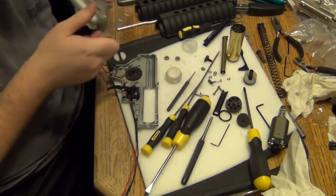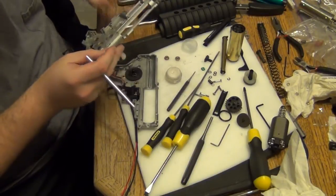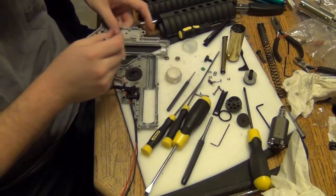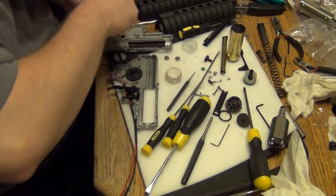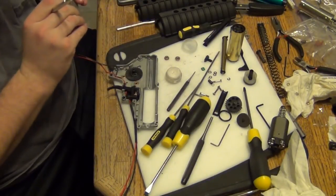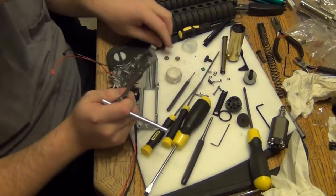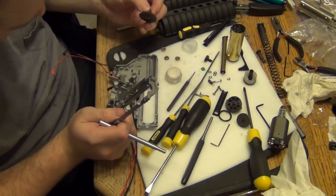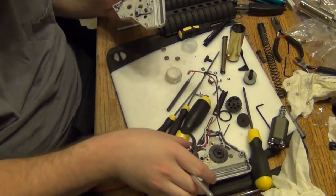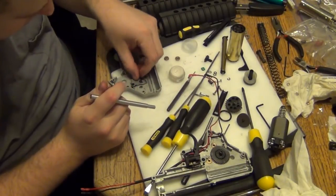When it's stuck in the shell, it's kind of hard to tell because you have to use a tool to push the gear up to see if there's any space. And if it's the gear that I'm talking about right now, it's kind of hard to see if it's moving. You can look at the bushing and see if there's any movement. But usually the best way I found from experience so far is pushing down the bushing or bearing and seeing if it moves downward. If it moves downward, you need another shim on the top. And you repeat this until it doesn't move, by which point you remove one. If you keep it where it doesn't move, sure, that's almost perfect.